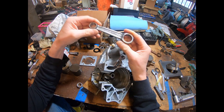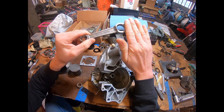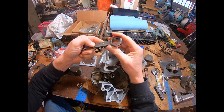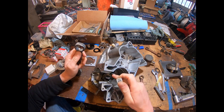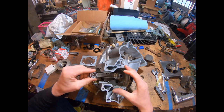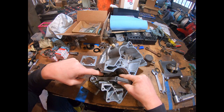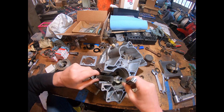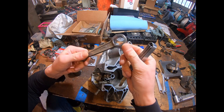The downside is the 15mm wrist pin had to be surface ground down to 14mm — I wouldn't mill it, I do that entirely on the surface grinder. The OD is actually bigger and stronger too. I have it mocked up with the case using a loose-fit pin and the original bearing just to check clearance. My general rule of thumb is roughly 10 thou clearance from crank web to case — I have more than that here and it doesn't rub anywhere.